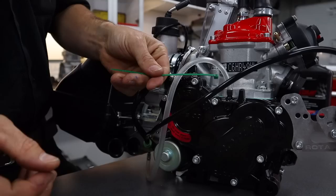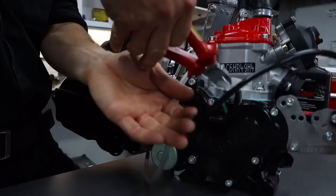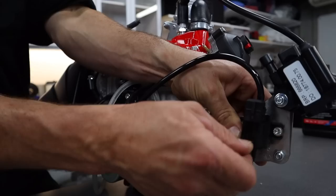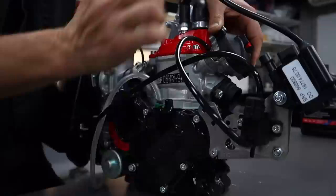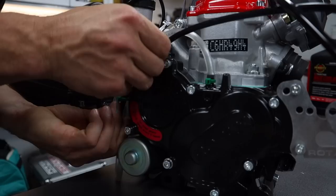To finish this job off I like to put a couple of cable ties on the vacuum lines so they don't fall off. Zip tie that up and make sure it's tight, use your side cutters and give them a little twist. Now we can install the vacuum line from the RAVE valve which goes across to the power valve. You may notice this one here has got nothing — that goes to atmosphere, so it always stays open. Lastly, just tidy the job up using a couple of cable ties to hold the vacuum lines nice and neat on the engine.